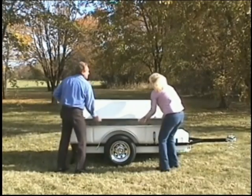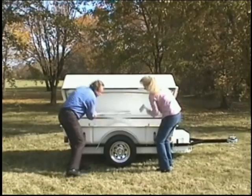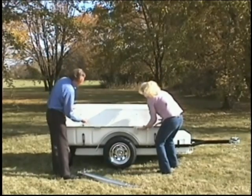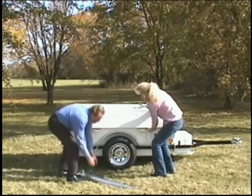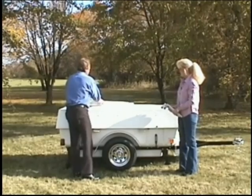Release the four-corner bungee straps and two lid locks, then lift the lid to gain access to the telescopic poles in the cargo bay. The four lid poles and two L brackets are the only items independent of the camper. Lower the lid and return the two lid locks. Remember, it is important that the camper section be locked down to the cargo bay during setup.